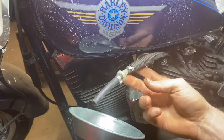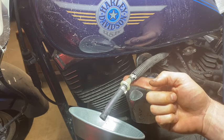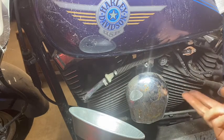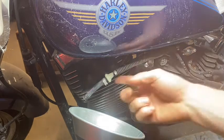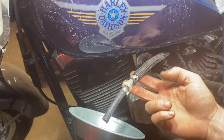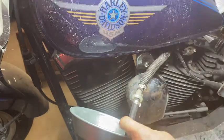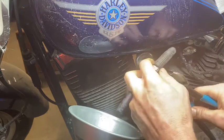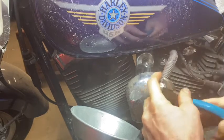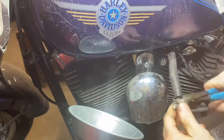On the other side of the motorcycle I've pulled the gas line out from underneath the gas tank. You can see right now - we turn it on and you've got nothing at all. What have we got in the middle of this fuel line? That little plastic thing is about a 20 cent fuel filter typically used on a trimmer motor - maybe a motor about a twentieth the size of this. This is 88 cubic inches of American steel and they've got a crappy little trimmer motor fuel filter on there.